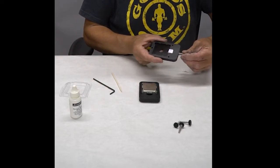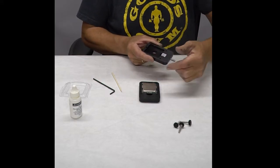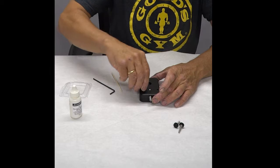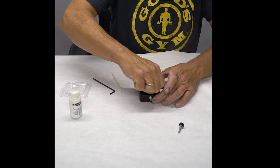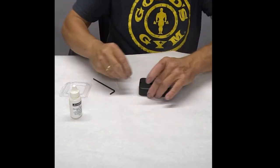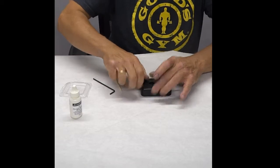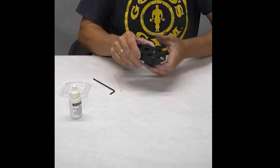The top is going to be put on. It has a metal block that's going to slide over and pop this top off. So I slide it all the way back, place my block on top here, and secure it with the 3 screws. You want to tighten these down, but you don't want to over torque them. You want it to be able to move a little bit, but you don't want it to slop around either. Just snug that down. I'm going to take up the play with my fingers.